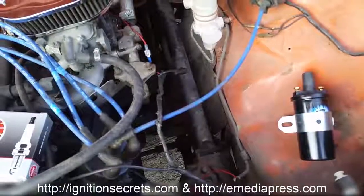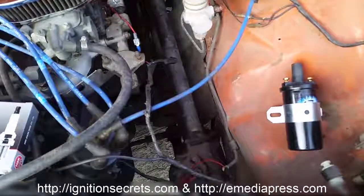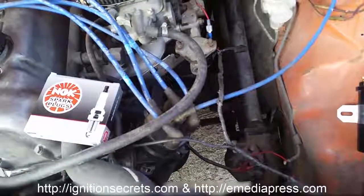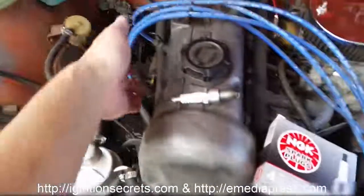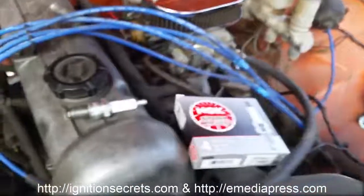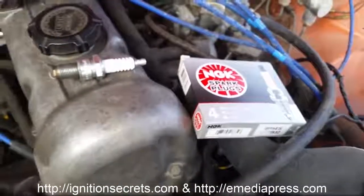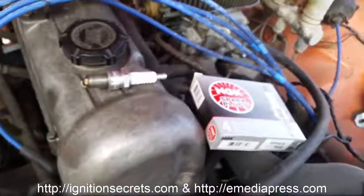And then once that's up and set, the next thing is to add my high voltage diodes from the primary of the ignition coil, which is going to be touching the positive of the capacitor inside of the CDI. Then I'm going to take the other end of the diode and run it straight to the top of each plug underneath the cables. And that'll bypass 99% of what leaves that coil, under the guise of eliminating radio interference. But with just non-resistor plugs, you get almost none, except for a few ticks on a CB radio, and it's very difficult to even find on the AM band.